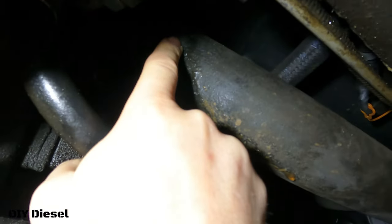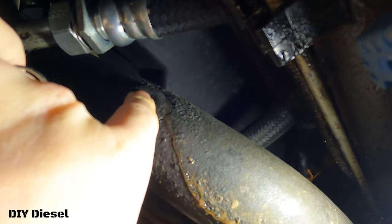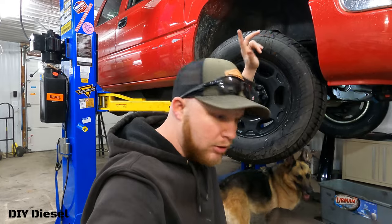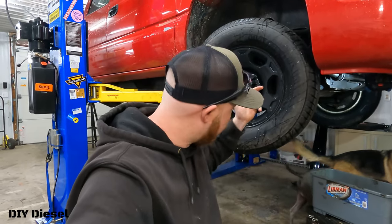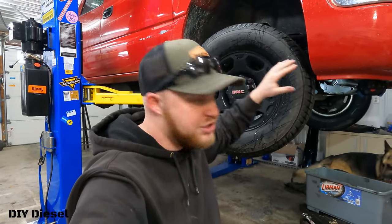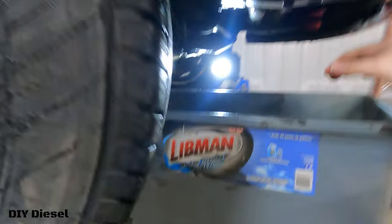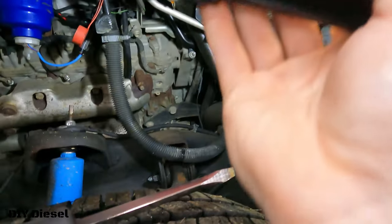You can see that this hose is leaking — squirt squirt. That's the main reason we're taking care of this today. One thing I forgot to mention: we took the upper radiator cap off the reservoir. Make sure you do that before you jack the truck up, to allow air to flow through when bleeding or draining. After taking the skid plate off, we're now going to take the front wheel well liner off to gain access to where we'll drain the fluid out.